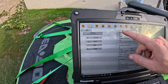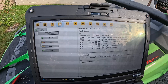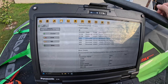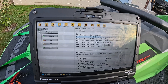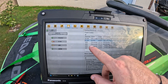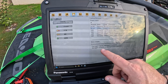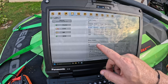Here we go. We can see there are faults on the ECU. We have a coolant temperature sensor fault — looks like it could be a short. Same thing with the injector: P0201. And then we also have a CPU timeout, so we may be facing an ECU issue, but we're not quite sure yet. The engine coolant temperature sensor is not as pressing because it has no feedback on engine performance. I'm going to start with the active one — the injector fault. P0201 is possibly a bad injector, bad wires, or a bad ECU, and it gives us service actions as well.